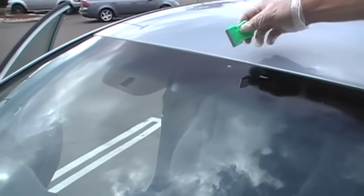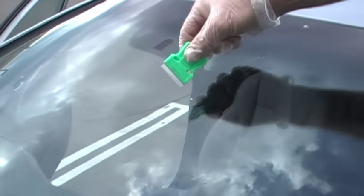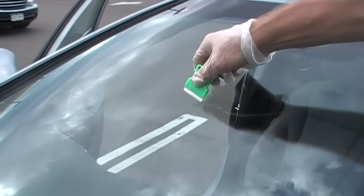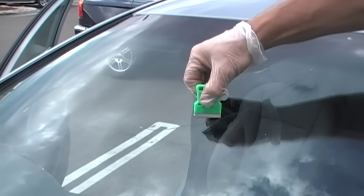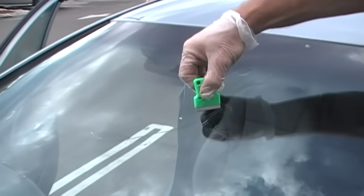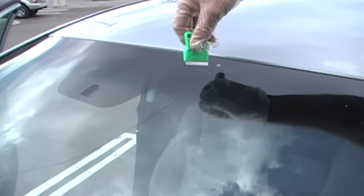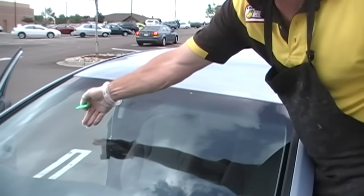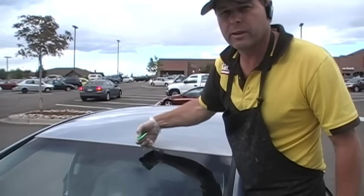Here's the crack — it started here, the big impact comes down, ends right here. These cracks are tight at the tip, and then as you go up the crack, they gap. You can see how the razor blade starts to catch in there, and it catches more and more as you go up. That's why we need to use a multi-viscosity approach — a multi-head injector that blends the resin, going from thinner to thicker as we go up to the edge.